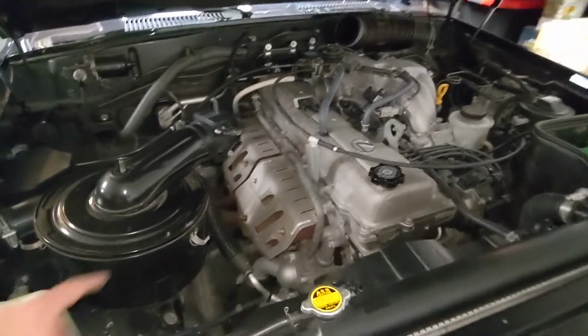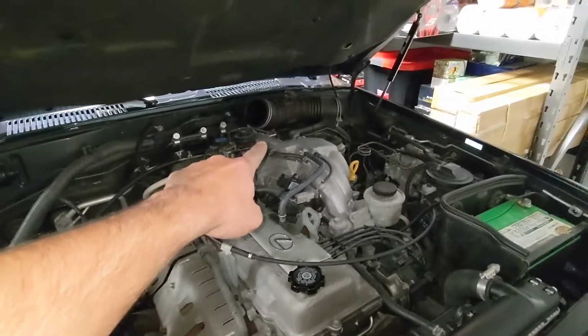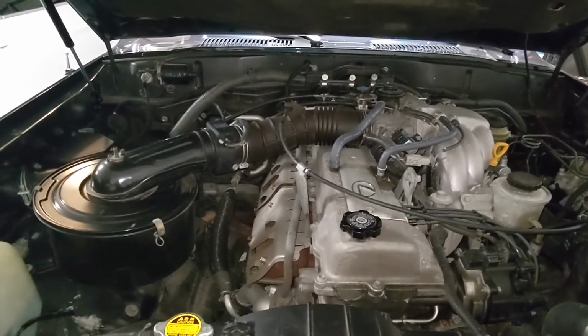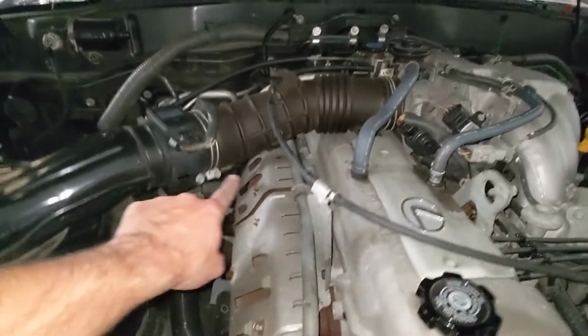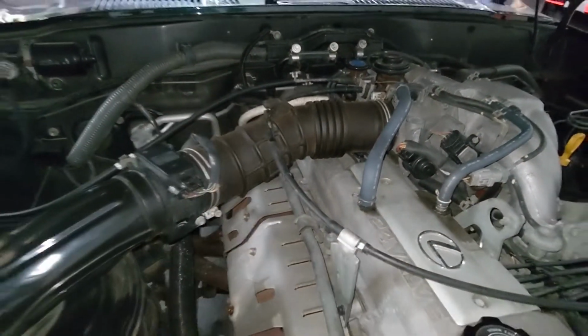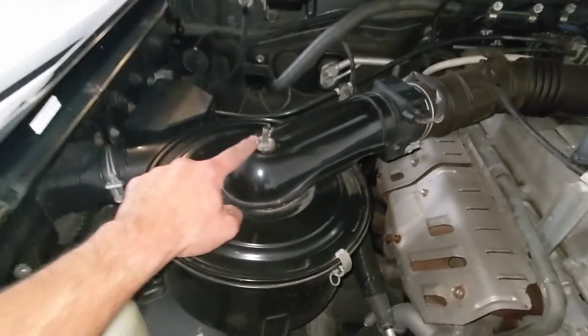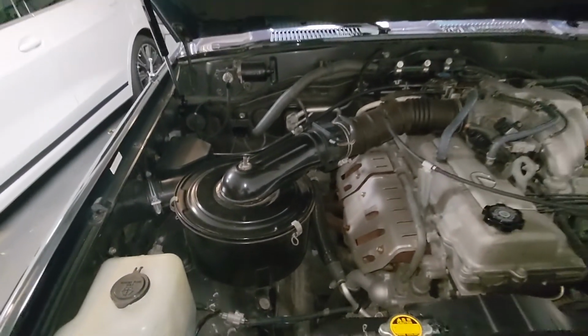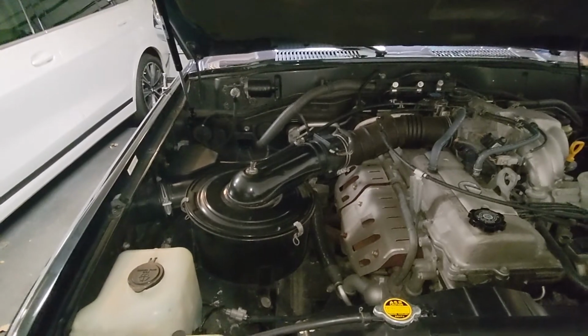Oops, one last thing. Let's get this guy. I put the hose over there, the intake hose. Let's get all that connected back up. That's all back in place. Make sure you tighten the clamp. Put this cable through that cable stay, and don't forget your wing nuts and your 3 clamps for the air filter housing.